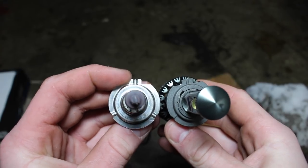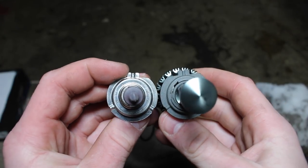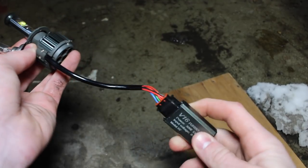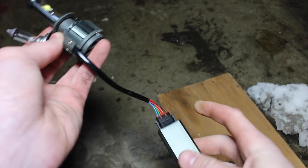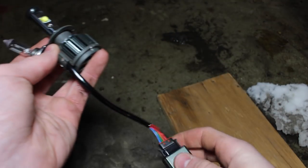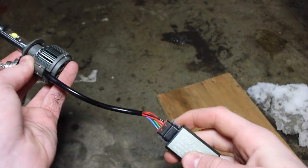As you can see, the stock and new bulb are the same style of bulb and they have the same focal length. Unfortunately, there isn't enough room for this power adapter to go inside the housing, so only the bulb will go inside the housing. We'll make a hole to run this connector out through the housing.